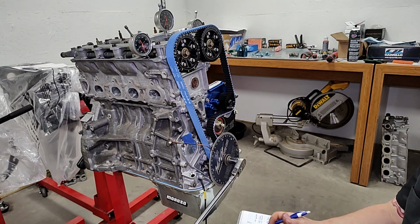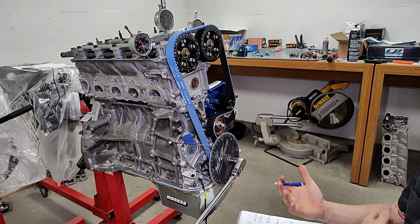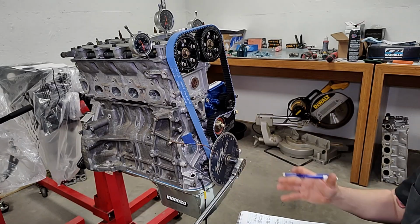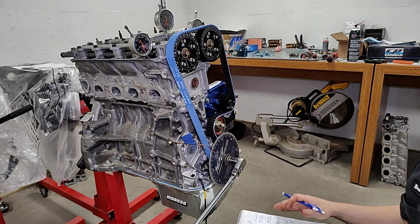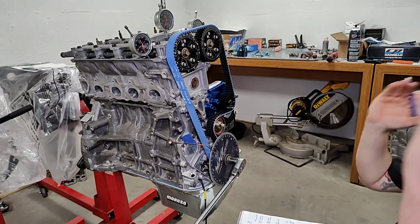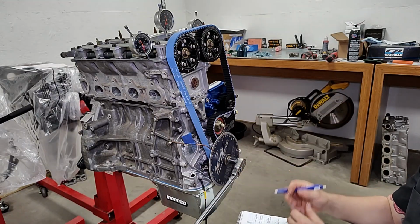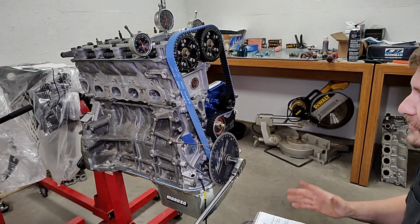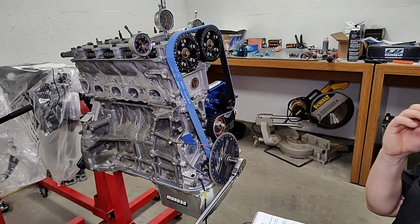And this is my favorite part of the engine build. Checking bearing clearances, you've got to know what you're doing, but it's pretty repetitive. And once you do it enough, you know, I'm looking for this much. I split the shell with this, and I get there. Every single cam is different. Every motor is different. I get to actually do it different every time. I mean, you saw how fast I torqued the head down. I'm really finding the fine tune.